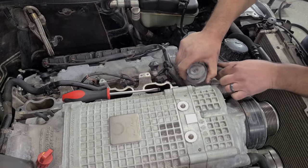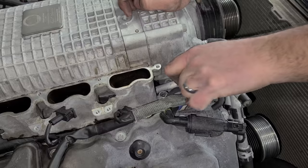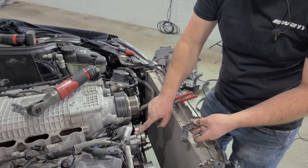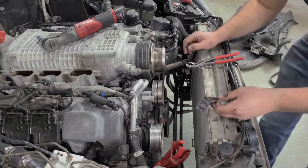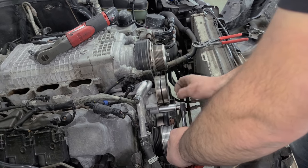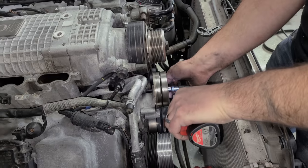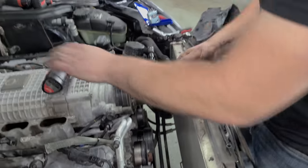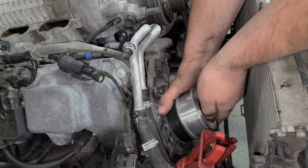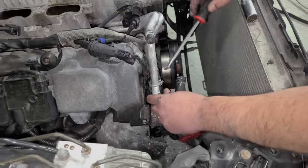I'm going to remove this tensioner for the supercharger and these pulleys here — we have to do this anyway and it'll make it easier to get the blower out. We have to get this tensioner into its service position to access both of the bolts and just jam a little drill bit in there to hold it. We just have two T40s. Not a bad time to replace this one — probably original. Now we can take the hoses off of the two intercooler lines, and we're going to lose just a little bit of coolant from these tubes.